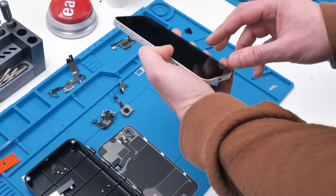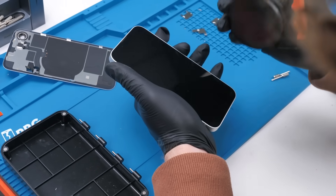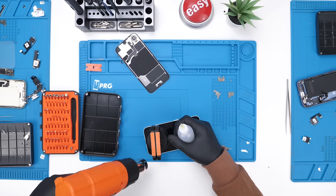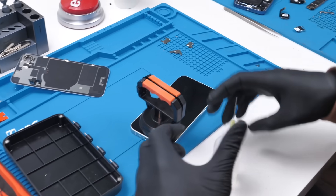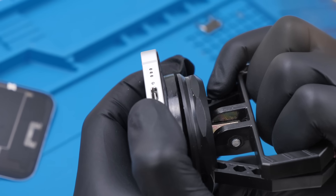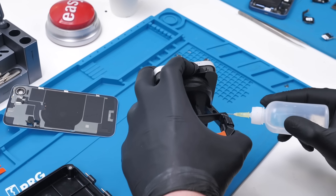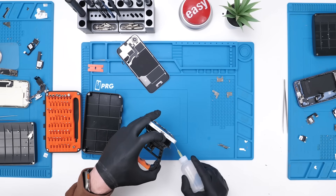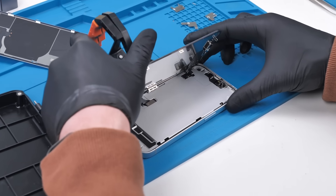Now for the screen — I went ahead and put everything back together. It's time to remove the display to test whether the iPhone 14 display works with this device. We'll use our suction cup, alcohol, and some heat to get this thing off smoothly. I'm always scared to burn an OLED display because they're made of organic material and they can burn. The display is coming off pretty easily. If the iPhone 14 screen does work, screen replacement costs will be significantly cheaper and parts are already available — we wouldn't have to wait.